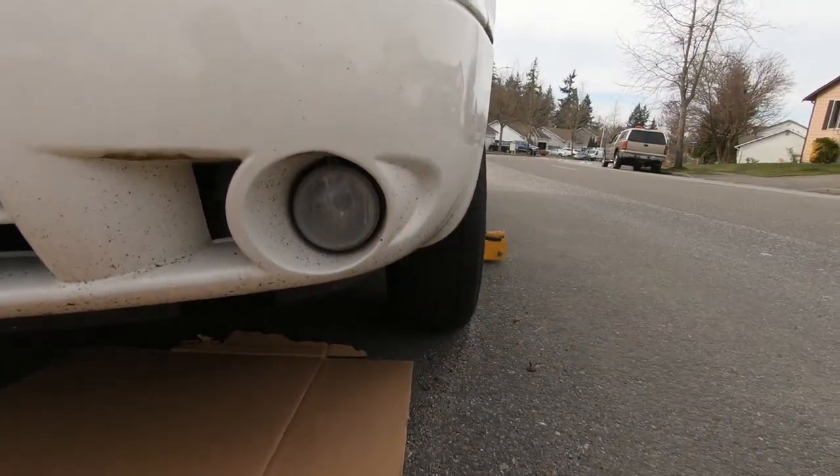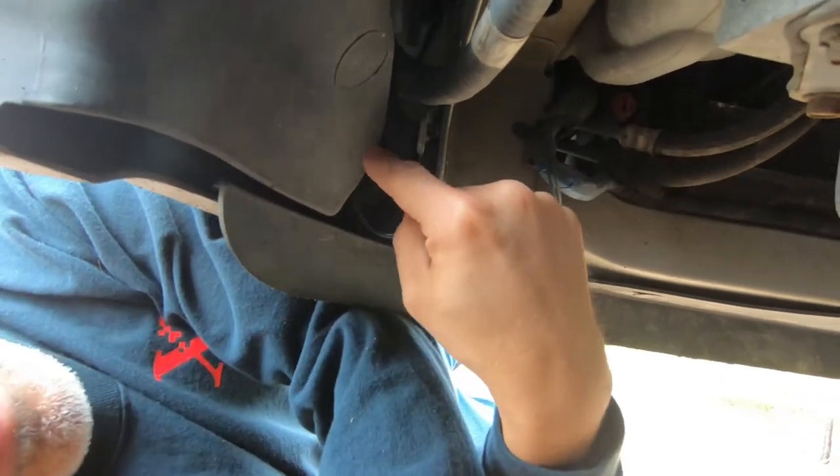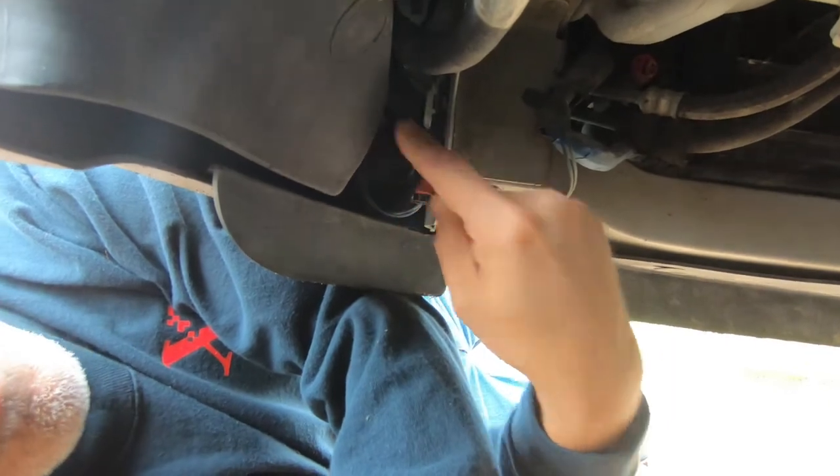What we're trying to do is replace this right here, so you have to get underneath — it is a little bit difficult to reach. The lamp is on the other side of this. If we look right up in there, that's where you're going to find it. You're going to want to turn it counterclockwise to remove the lamp from the fog lamp housing.